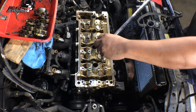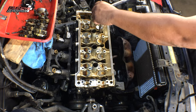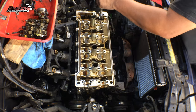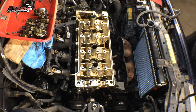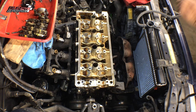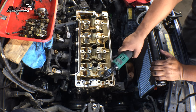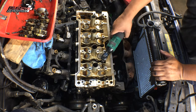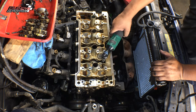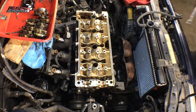I actually picked up that socket from Lowe's. I'm not doing this in any specific order — I really don't care. I know some Honda and maybe even Toyota manuals recommend that you take off the head bolts in a specific order, and they do that because they want the head not to warp. But if you're going this far and you don't send it to a machine shop to have it straightened and planed out, it's kind of pointless — because if the head is warped and you put a new head gasket on there without having the head machined, you're just asking for another blown head gasket. So don't skimp out and not send the head to a machine shop.